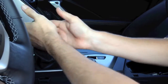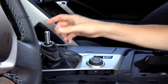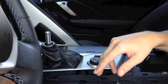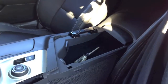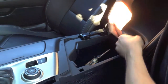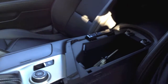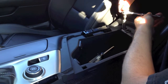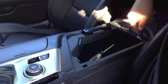Again, this was a temporary installation for prototyping on this particular car. Now that that's free, and assuming you've got your factory boot loose and the Torx screw from the side of the shift knob removed, your factory shift knob will just slide straight off the top. So now with the shift ball loose and out of the way, we're going to take the rear cover off. This plastic cover holds on with two retaining clips and a 10 millimeter nut. You'll simply use a quarter drive tool of your choice to take the hex 10 millimeter off.